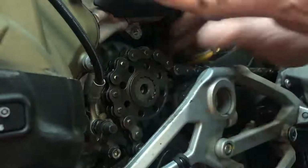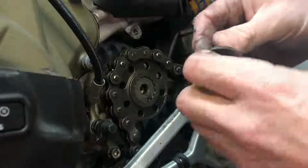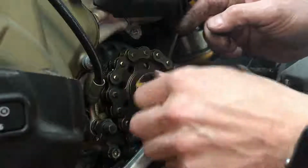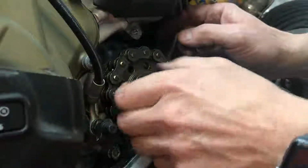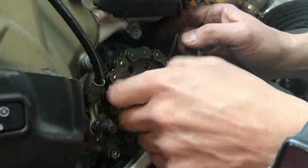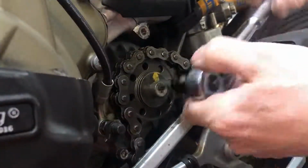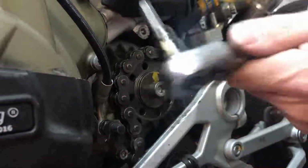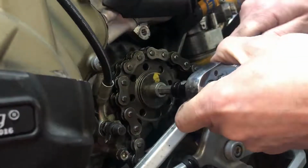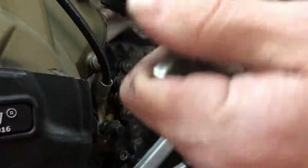They will not work. So then what we do is we take our bolt. Some people Loctite them. I'm going to safety wire it, so I'm not going to Loctite it because I don't really think you should. Probably should, but I'm not going to. And we put that on nice and tight. So as you see, we took our 8mm socket or Allen key here, and we're tightening up. And we found our torque wrench, and we are going to torque it up.